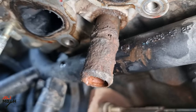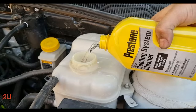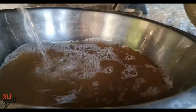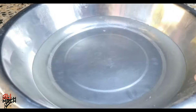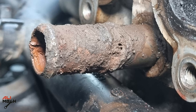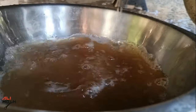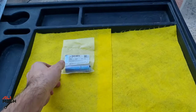By the look of the rusted metal pipe, there is so much rust still in the engine, even though I used cleaner and flushed the system many times till the water got clear and refilled it with new antifreeze. When the engine has been running with water instead of radiator coolant for a long time, cleaning will be very hard because we need a harsh chemical for the rust that is also safe for gaskets and all the pipes. So if you've used any radiator coolant cleaner that you think is good and worth trying, let me know in the comment section below.